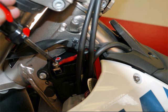To tighten the terminal screws, we recommend the use of a number 3 Phillips screwdriver, as this allows you to apply downward pressure on the terminal screw. That helps the threads catch and reduces torque on the terminals. Check that the positive terminal of the LFX battery can't short against any part of the vehicle, and be sure that the original positive terminal cover, if any, is reinstalled on the LFX battery before the battery box cover is fitted.